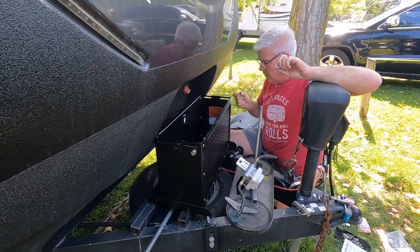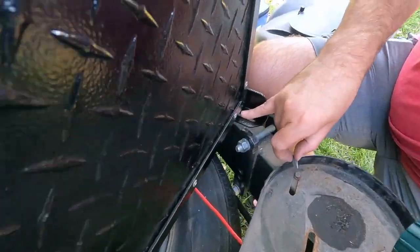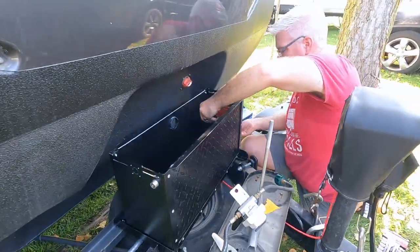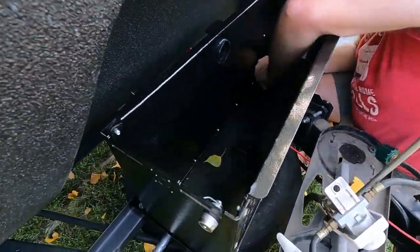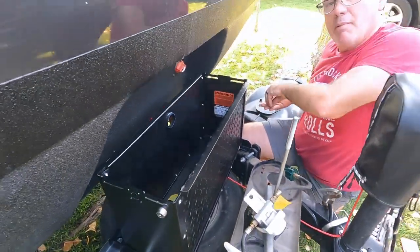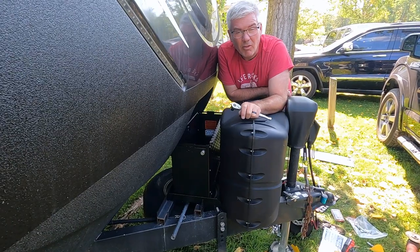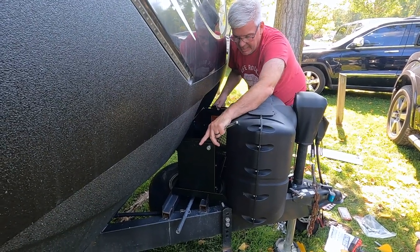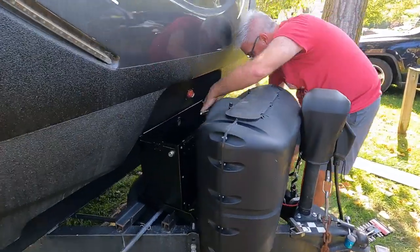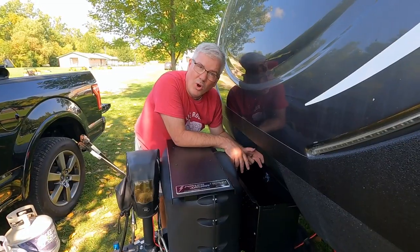I've got these bolts with a little rubber spacer. I'm putting the rubber spacer here between the box and the rail just to help take out some of the wiggle and jiggle. I'm getting these in place in a preliminary fashion so I can check my measurements and get it where I want it on the front to back. Then I put the propane tank cover back on so we can get the adjustment to exactly where we want it for maximum space. Now I just have to tighten down the bolts — it's a tight fit.